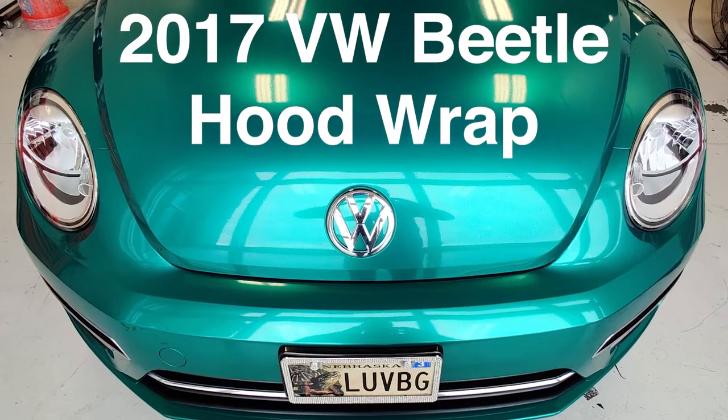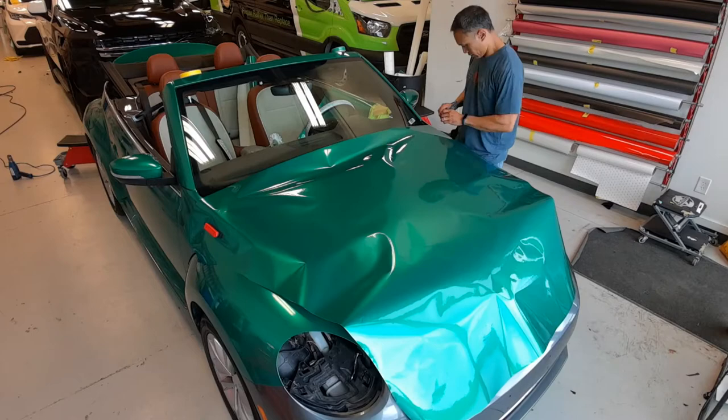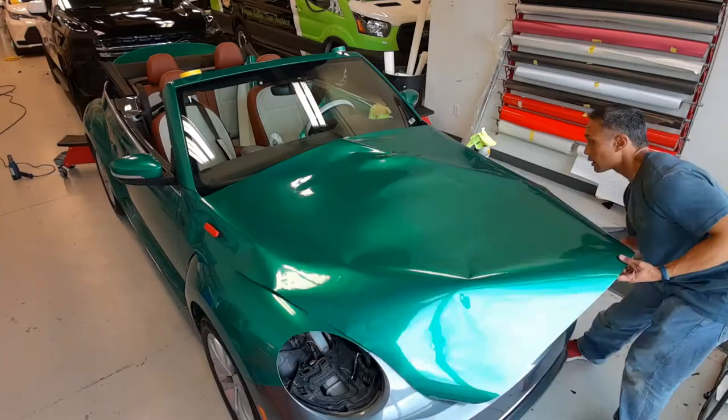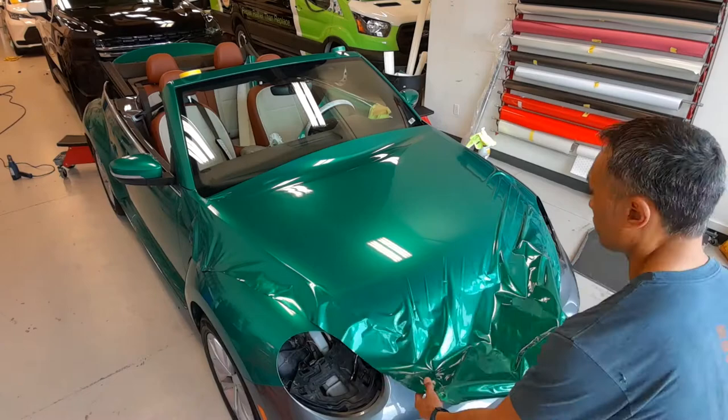In this video I'm going to show you how to wrap the hood of a VW Beetle, which is a challenging hood because of the bulbous shape of the hood itself and actually the whole car. Here you can see I've got a piece already pre-cut sized to cover the entire hood top to bottom, left to right, giving a little bit of extra all the way around. I went ahead and peeled off the backing paper and now I'm going ahead and glassing out the vinyl across the main, mostly top surface of the hood.